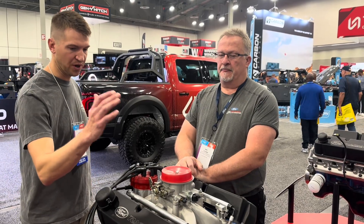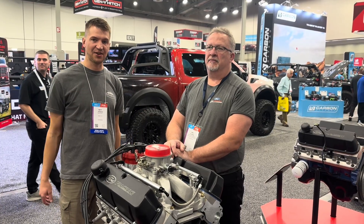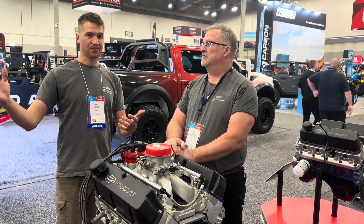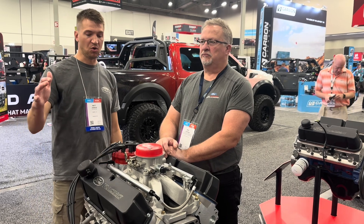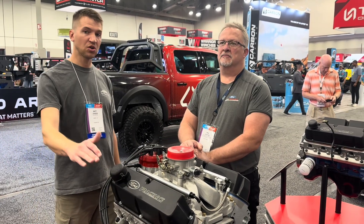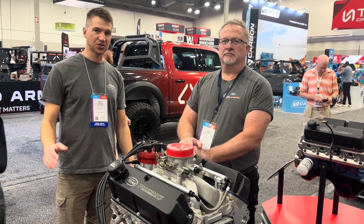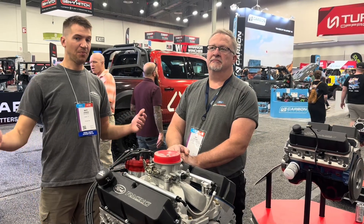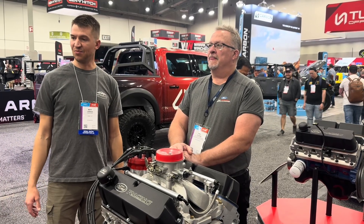So that's what we're going to be doing. We're going to bolt the 460 Boss to the T18 in our 1985 F250, and we're going to bolt it in with just factory motor mounts. We could either reuse our fuel system with a carburetor, or we can go to aftermarket multi-port fuel injection, which is what we're ultimately going to do. You have an old-school classic throwback that's totally modernized with multi-port fuel injection. That 460 outperforms the Godzilla — handily outperforms the Godzilla. It is a really, really cool option.